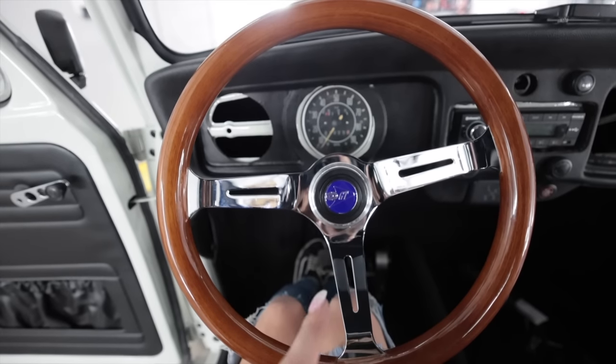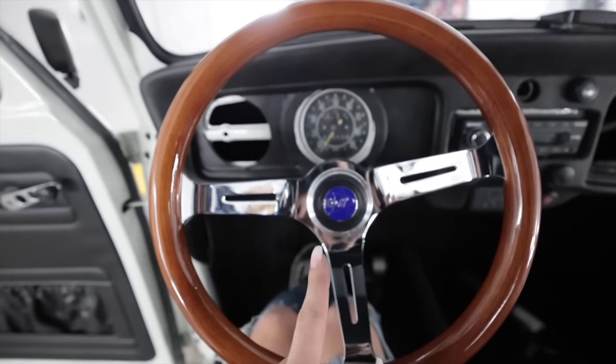That's what's up. That looks so good. I didn't snap the horn button in all the way just yet. I want to make sure that the wiring works for that circuit before I click it in, because it's kind of a pain to pop it back off. And the ground that goes through the steering column, I might need to replace that because I didn't get continuity when I checked it before.